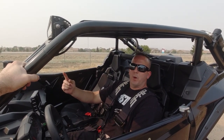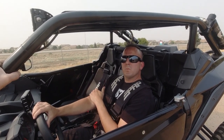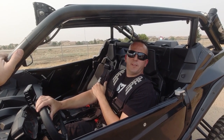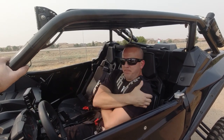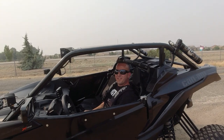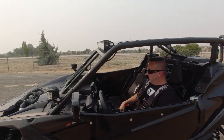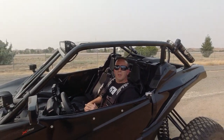Over at the other one, I swear it just pulls. This time it just feels like you're on a roller coaster — you can feel yourself just in the backseat. I wouldn't doubt it because you're up over 21, up about 20. How did the boost go? It cracked right underneath 21 — like 20.76. And then after that, looking back, it was 19.76, 19.78. Mine's doing about that too — I'm not seeing 22. So now could that be the clutch weights? It could be something like that. We need to throw the big ones back on to do a direct comparison. But to be honest with you, man, I do feel that rush. You're a minimum three pounds more boost. I just feel like it's great off the launch. I feel like it's stuck mid-weight getting to 60. That could be clutching. This is not a good test — you're throwing the clutching off with the tires. But we know that it's getting some boost now. Oh dude, I definitely feel the power. The launch — I definitely feel it.